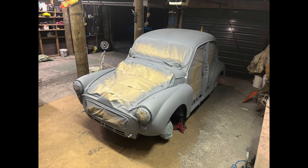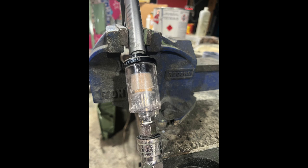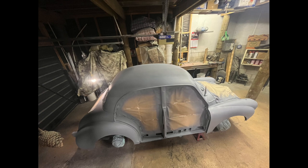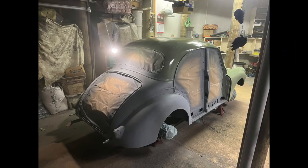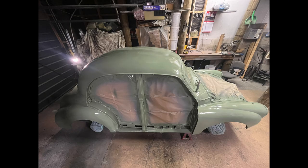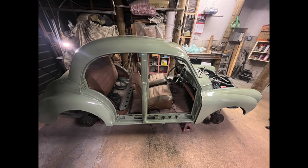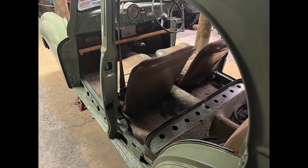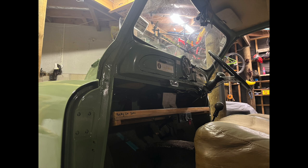Here's the vehicle after primer. The inline dryer on my spray gun actually started to fail, but luckily it was still usable. And now for the colour coat, like the rest of the parts. I let the paint cure for about half an hour, but while it was still soft I removed all the masking paper and tape. And this is the final result.